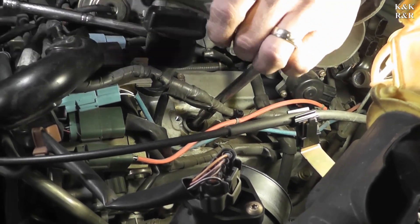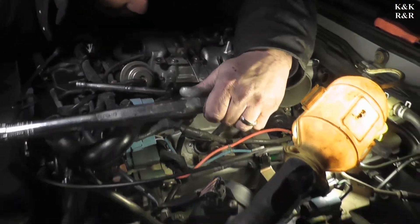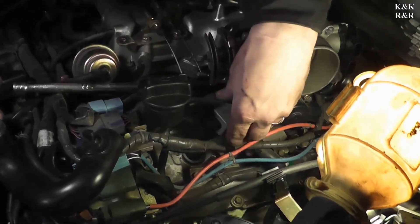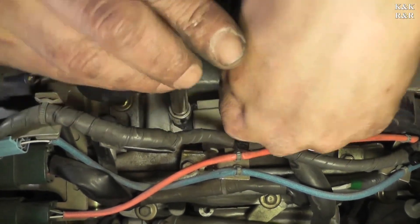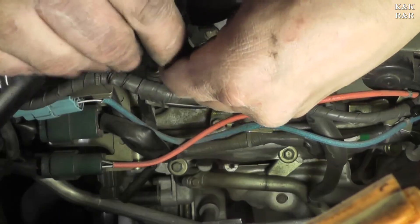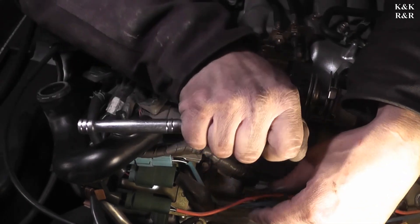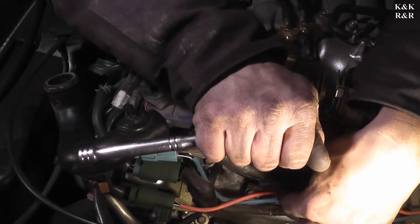Already hit 14. I just want to make sure it's consistent all the way around. There's a little bit more room on this side to actually hold the bolt all the way down — no magnet tool needed on this side. About 10 to 12 pounds of torque on the coil bolt — just do it by hand. What I like to do on these that are 10 to 12 pounds: I'll literally take it and go like that. More torque here means more torque down there, and you just want 10 to 12 pounds. And that'll give you your best 10 to 12 pounds.